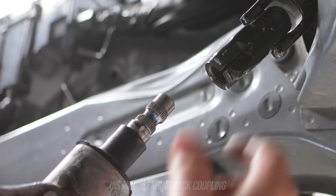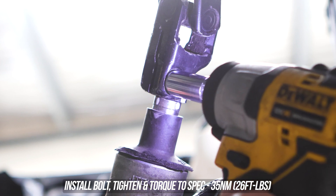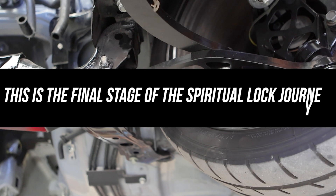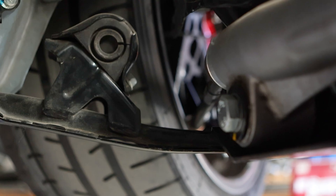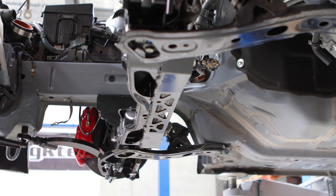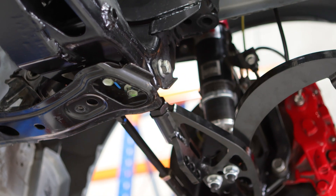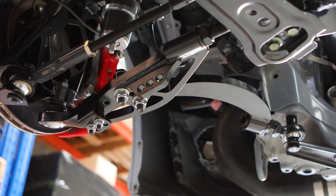Being that the steering column is a slip-on joint, go ahead and pull that down and into place, obviously lining up those marks you definitely put on there earlier. Throw that steering column bolt through the coupling and tighten and torque that to the specs shown on the screen. At this stage you're in god mode with our full pro setup. With this being said, you probably don't have your sway bar fitted, which would give you the ultimate lock as that pesky thing does reduce clearance. One thing to note is that the rack relocation kit actually reduces your Ackermann, making it have more parallel steering — something to keep in mind whilst adjusting your alignment and knuckles to suit. Go ahead and refit your subframe brace and suspension arms back up to the subframe. You can enjoy the extra clearance to your inners and outers now that they're not hanging out the back, and they can sit further up to avoid those binding issues.